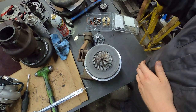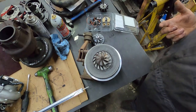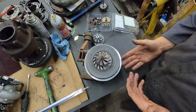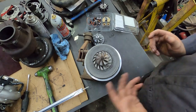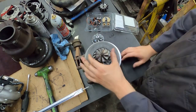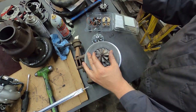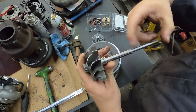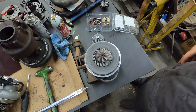I'll cover oil leaks and problems in the next video. On the turbine side, the same ideas apply — however you pronounce 'turbine,' it doesn't matter. Typically the compressor wheel will fail faster when bearings start to go, because the tolerance is tighter and the bearing is considerably farther from the compressor wheel tip than on the turbine side. Anyway, like, subscribe, comment below, and remember — it's not rocket science.